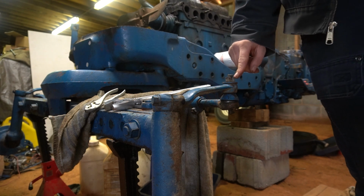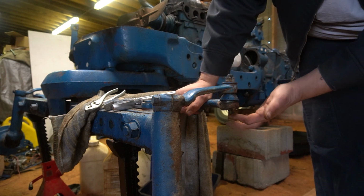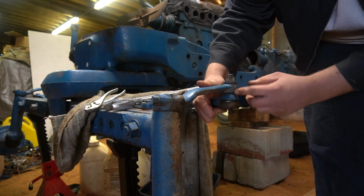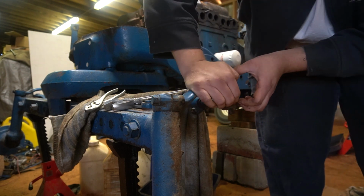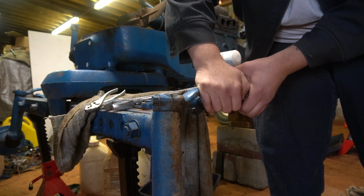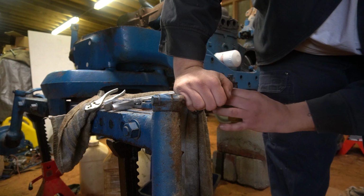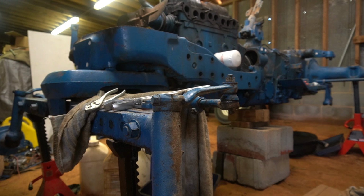If you're lucky, an impact will pull it off. That's number one. The second is to put pressure up on this to ram the joint up into your arm, to put some friction pressure on it to help get it off. Your third option, this is hard as a rock, is to actually reach in here with a pair of vise grips and grab the joint itself and hold it and spin it. In my current situation, with my limited tool availability down here, I'm going to try the jack first. If you have access to an impact, do it first.